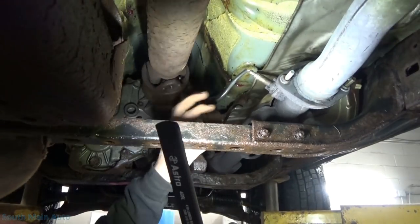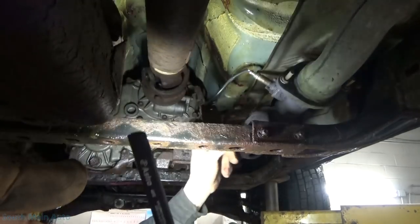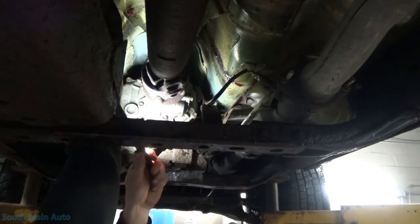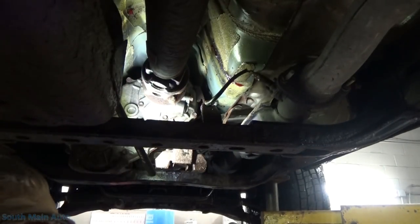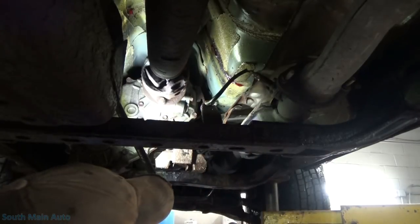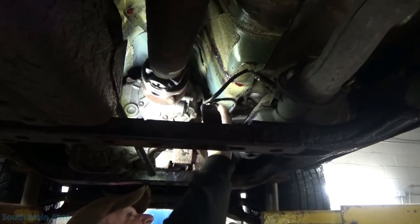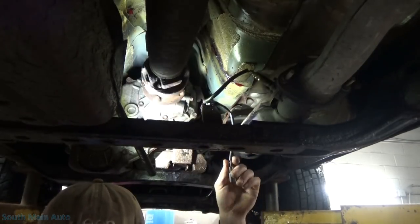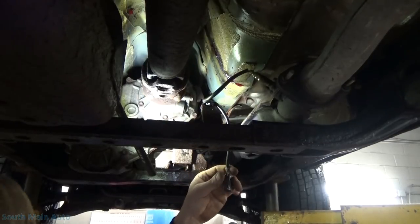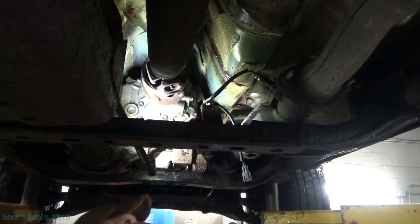This is the home of the rear O2. The bolts that hold it on are a little crusty. We're going to be careful not to get twisted up in the driveshaft. I left it running because I wanted to see if there were any leaks — it sounds pretty tight. Now looking at the scan data, it is still at zero, which tells me it's unlikely there's bias voltage on that.